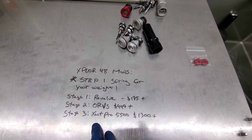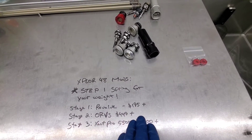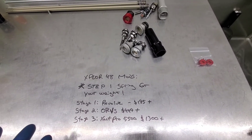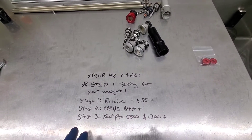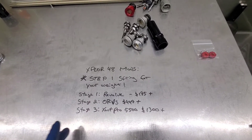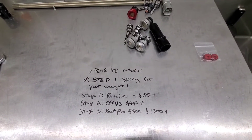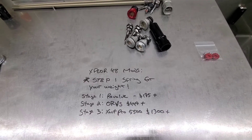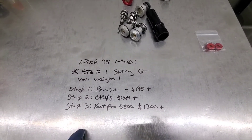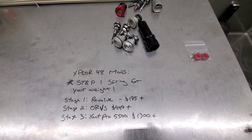Stage three — if you're really pushing it hard. Most guys will get by with the off-road valving system if you're a faster or more aggressive rider looking for a more progressive suspension feel. Keep in mind these are trail bikes — yes, you can valve and set them up to go fast, but it is what it is. Especially with the PDS shock — it's better than older generations, but you have less fluid so the shock fatigues sooner. It's a 46mm body instead of 50mm, the reservoir is smaller and holds less fluid than older versions.